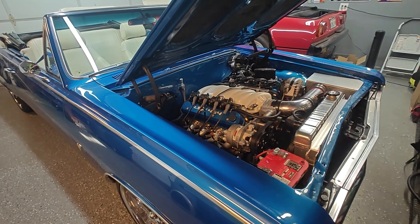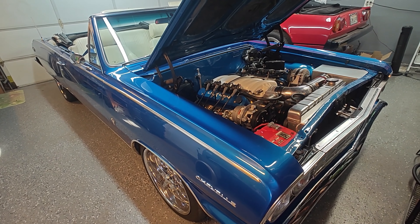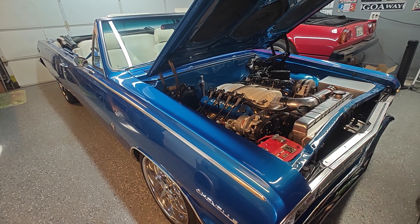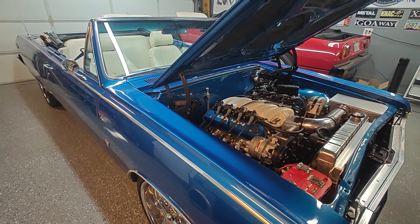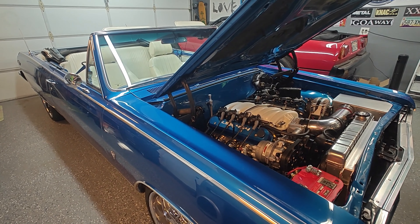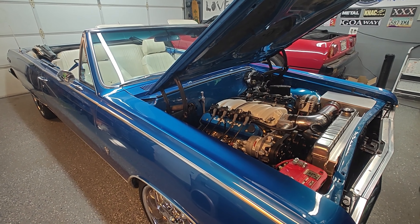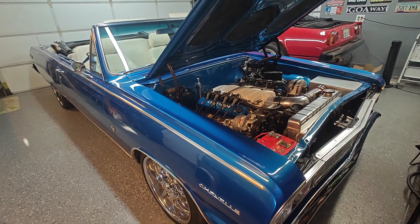It's always been there. It's not greasy or oily — it's soot, but it's black. I always thought because it's got such a gnarly cam that it just isn't burning fuel at idle. It's really toxic when you're sitting here in the car idling — you can smell unburnt fuel because there's just so much cam. My tuner said there's just not much you can do about that at idle when you've got that much cam.